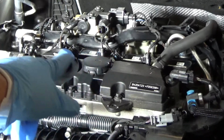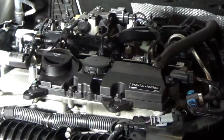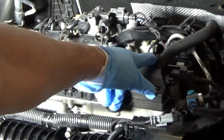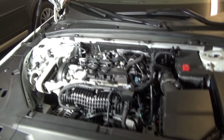And the reason for that is if you connect it, it'll be in the way of the next spark plug. Like if you go 4, 3, 2, 1, and you hook everything up, that connector right there is going to be in the way of 3 getting in there. All right, I'm ready to put the cover on, but I'm going to do a tool check and start the engine, make sure it runs smoothly, make sure everything's connected, and all that good stuff.